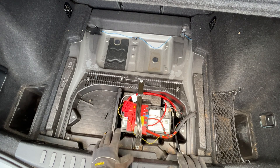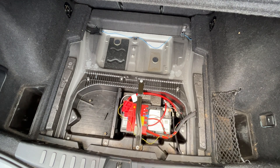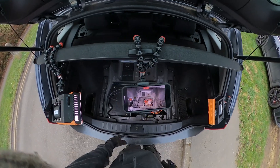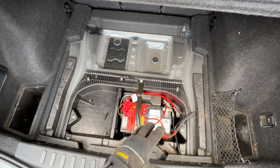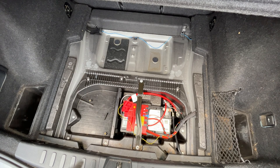We're going to take the battery out, but the really important thing is once you replace the battery is to tell the car it's got a new battery, because it charges at different rates. An older battery will be charging at quite a high rate; a new battery will be charged at a much lower rate because it doesn't want to risk damaging the cells. It's got a whole algorithm it uses, so do make sure you get ISTA set up. If you don't know what that is, don't worry — I'll show you at the end of the video. There are chapters marked in the video description.